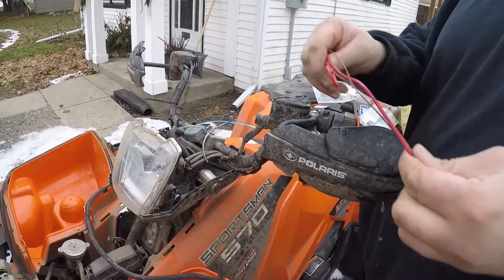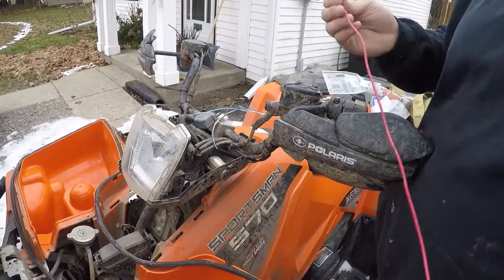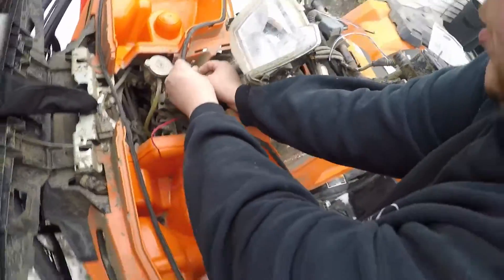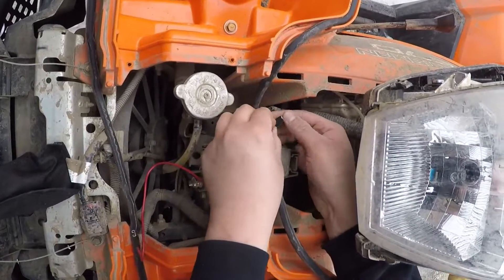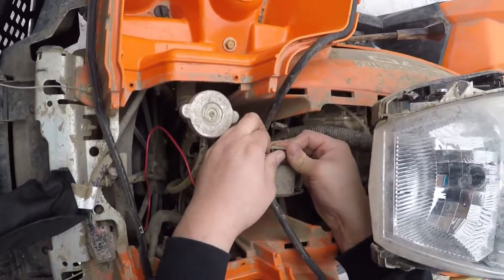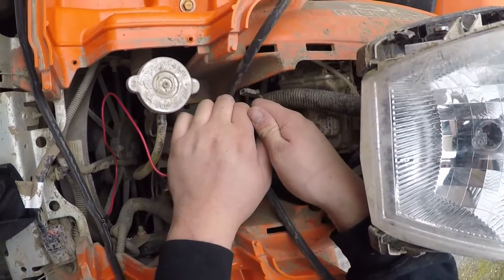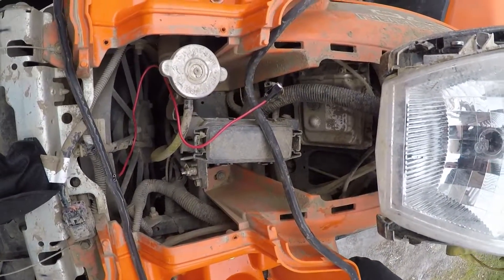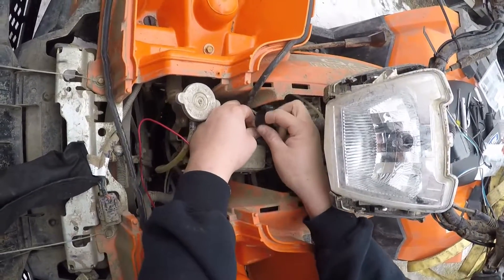Take the remaining wire — the red and brown wire from the package. Red is for your constant power to the rocker switch, and brown is the ground for the system. Install the blade end into the power point — it's a compression fit and it'll be very snug. Press it until it seats in its base. Take some electrical tape to seal that connection up from any water, dirt, or debris.